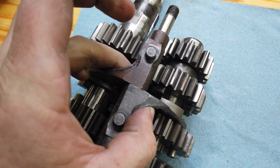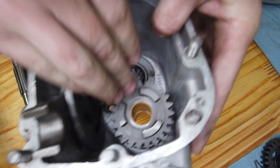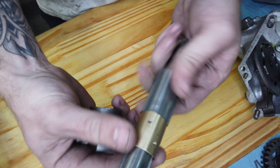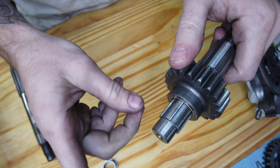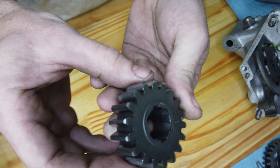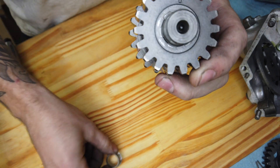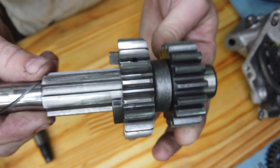Take your fork gear — output gear, high gear, whatever you want to call it — and drop it into the bearing in the case. Now take your layshaft and put your new bushing on. Take your third gear and slide it on with the shoulder side facing towards the inside of the cover. The layshaft high gear — fourth gear — has a slight shoulder right here, and then a smooth side. The smooth side fits against third gear, so that little shoulder will actually be riding on the inside race of your bearing.